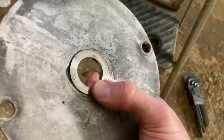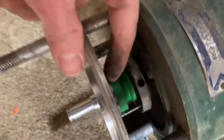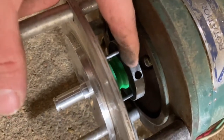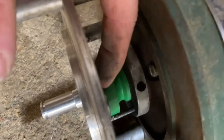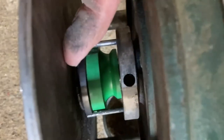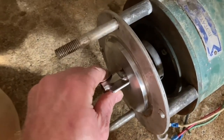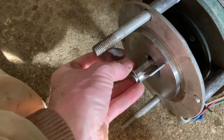The next step is the plate, and the ceramic rests against this piece on the plate. Nothing is tight right now — everything's got slack in it. We'll actually pry between this piece and the motor housing once everything is put together to make sure everything's tight between the steel plate and the ceramic piece. If you don't have it tight you'll have a lot of air bubbles and the pump won't work. The last part is the impeller — it just lines up with the grooves and then a clip goes on the end. That was what we were missing last time that caused all the drama.